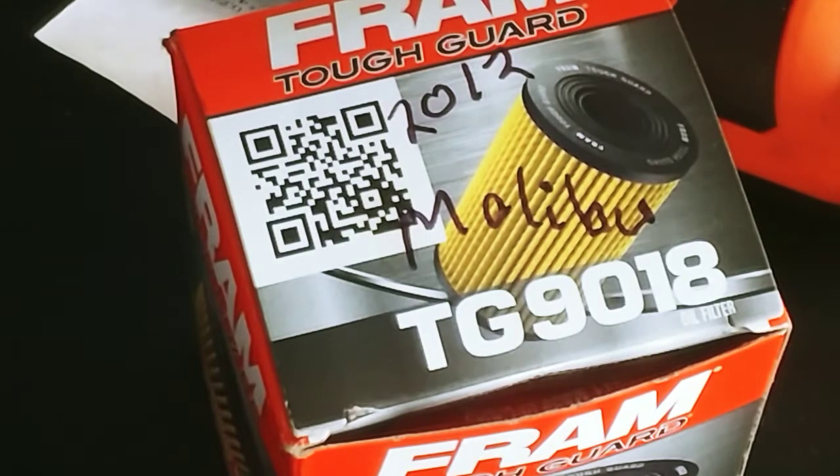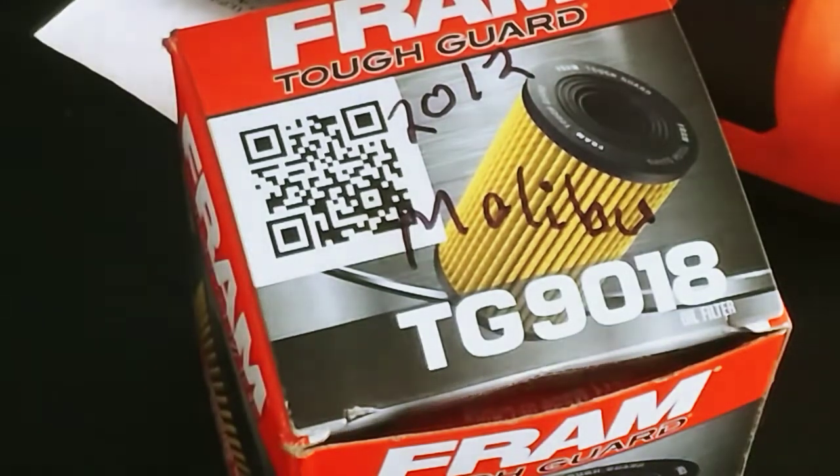Jacked the car up, secured it, used my tool to take the bolt out, drain the fluid, put it in the bucket, lubricated the screw after I cleaned it off, of course, lubricated it with a little bit of the old oil, put it back in, and it was a bit of a mess. Not much of a mess, but a bit of a mess.